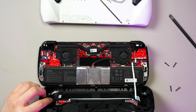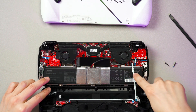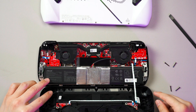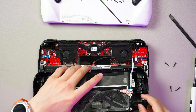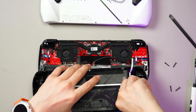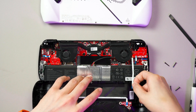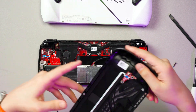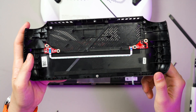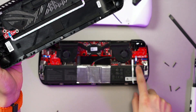It opens up more space on the motherboard for the battery and also the 2280 M.2 SSD. The ribbon cable is easy to take out — it's just one flap here. Open it, then carefully take the whole thing out. Remember, don't yank out the back piece; there's one connector here that connects to the main board.